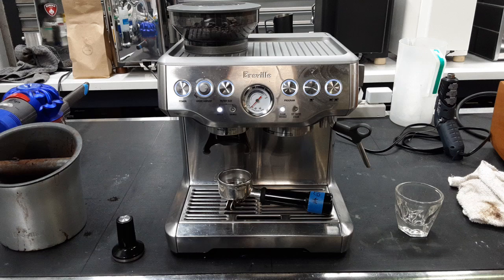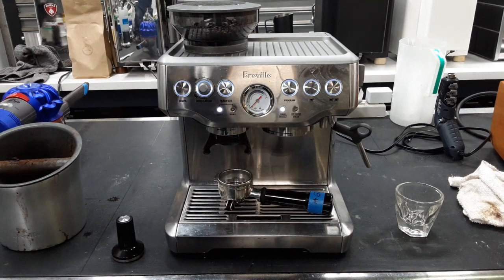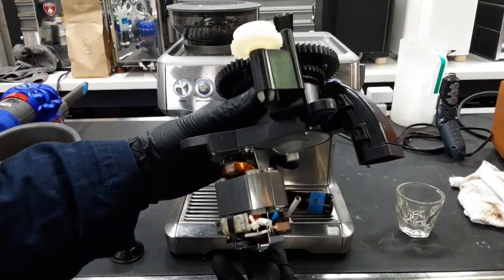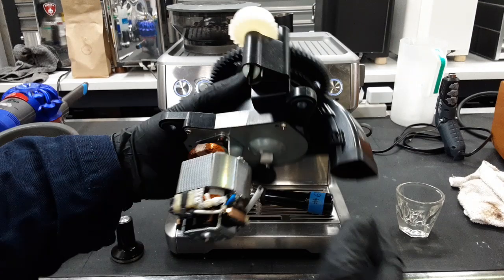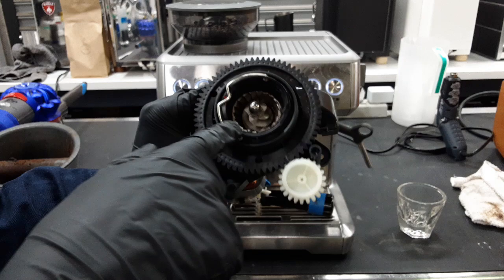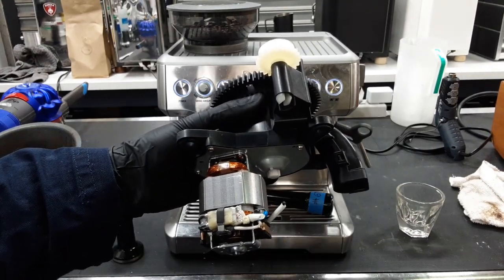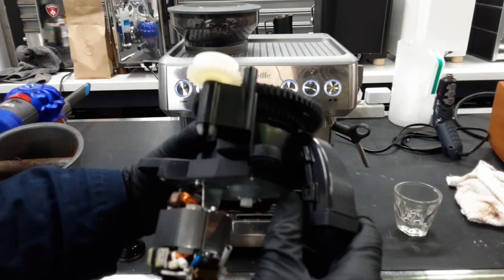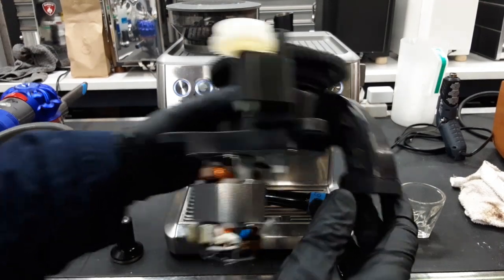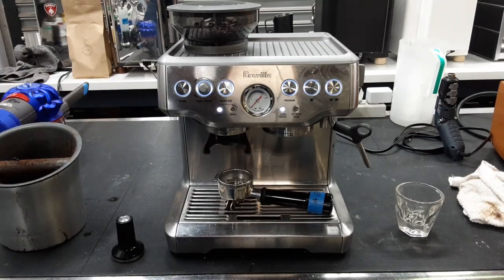The grinder keeps revving on itself and it'll actually die out. So what happened with this grinder — this is the original grinder right here in my hands — I had to cut the wires off to get a new grinder in there. As you can see, all the coffee goes in and comes out the chute. The rock went in there and the part that spins couldn't spin anymore, so it kills itself and gives out. We had to replace the entire grinder assembly, which is why I have the old one here.